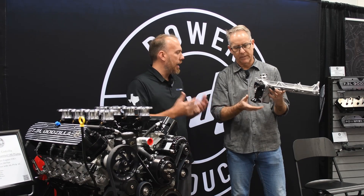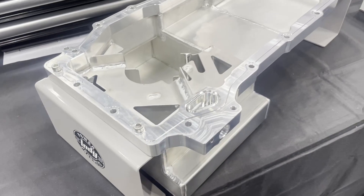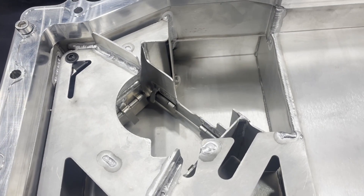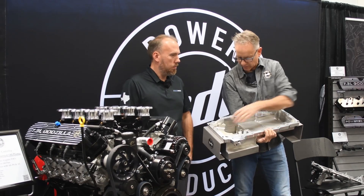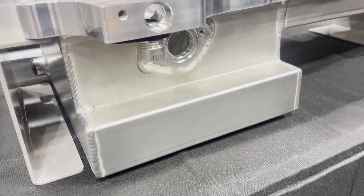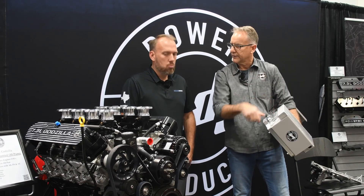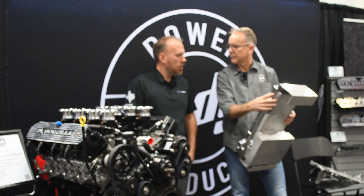With such a trick product, it's got to have a neat oil pan to go with it — you're not going to use the factory oil pan. Our oil pan that goes with that, like all our oil pans, is fully baffled and trap door. It's set up for drag racing and road racing — it has all the trap doors in it, and all your fittings over here. Oil out on the same side of the oil pan as oil in. And you have an option to run the oil in horizontally or vertically. This is a pre-production unit; in production, we've got a turbo oil return up here as well.